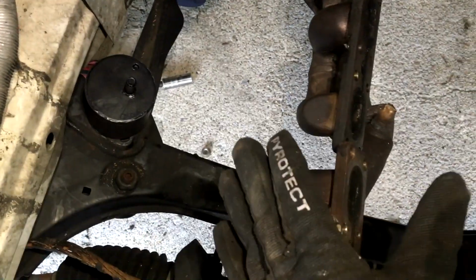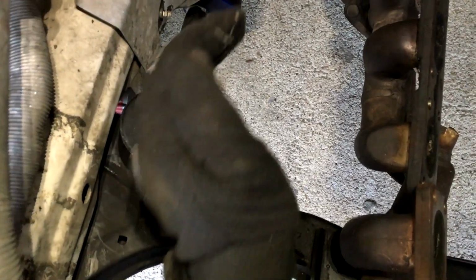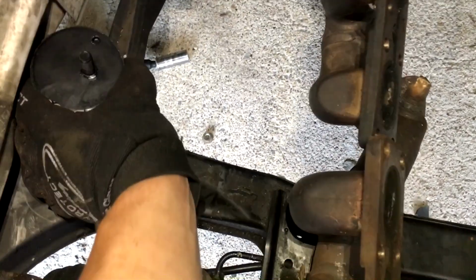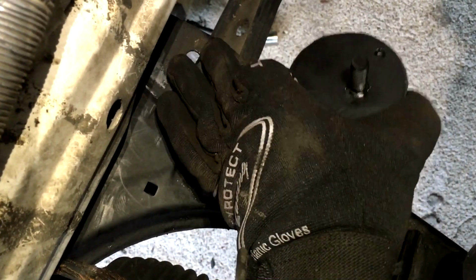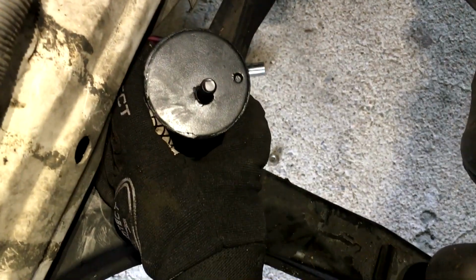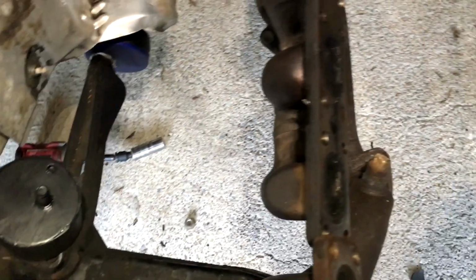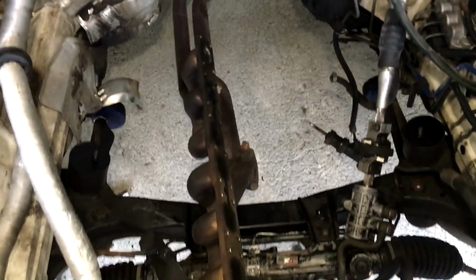So the distance between the studs is maybe about 1/16 closer, but pretty much identical. And it'll kick the engine back about 1/8 inch because it's just clocked back ever so slightly. If you wanted it to be a perfect fit, we could drill a new hole 180 out just behind this one, or grind off our alignment stud and just hand clock it. But I really don't think 1/8 inch back is a big deal. If anything, that's a tiny win for weight distribution, but the big win is $20 for solid mounts.